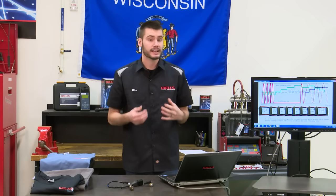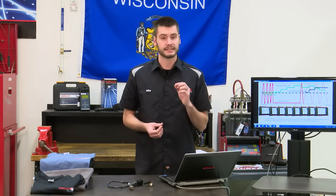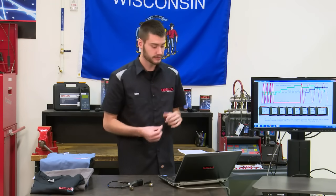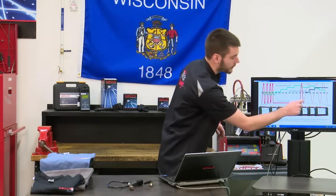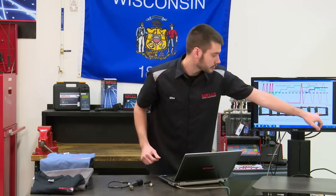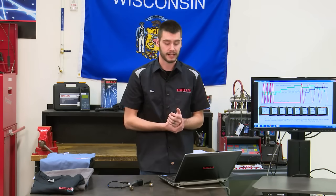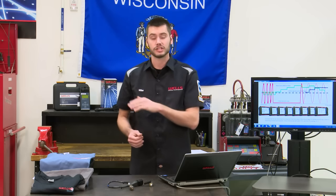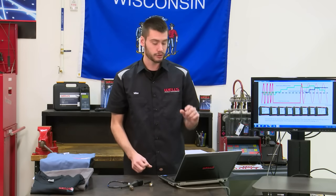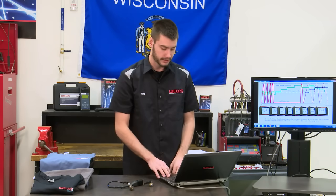If you remember from last class, I talked about our long-term fuel trim's goal is to satisfy our short-term fuel trims, okay? So in this vehicle, to satisfy our short terms and bring them back to this happy switching like we're seeing right here, we have to see a long term of a +3 and our short term switching between the +1 and the -1. And again, I have the GTO all set up. I hopefully, if everything goes right, we'll be able to show you guys real time the fuel trim reaction to the way the oxygen sensors are working.